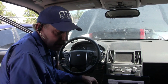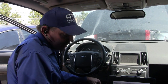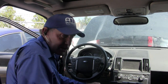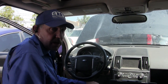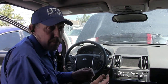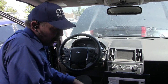So I don't have a pinched wire or anything like that. This is one of the modules that's bad, or they're not powered, or something — we need to get there. But this is some type of module being pulled down. Now I know that a module is pulling the bus down, and that has to do with the CAN transceiver failing. The CAN transceiver on CAN systems is what does the arbitration — it sets the priority, determines which module can get in and what order messages will be sent and received. They also control the voltages, so when one of these fails, the voltage goes down.